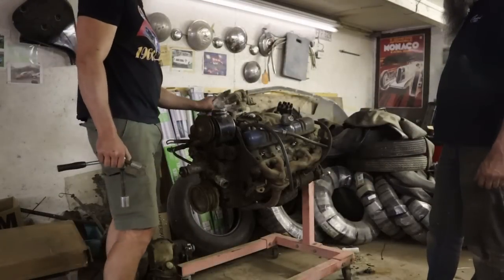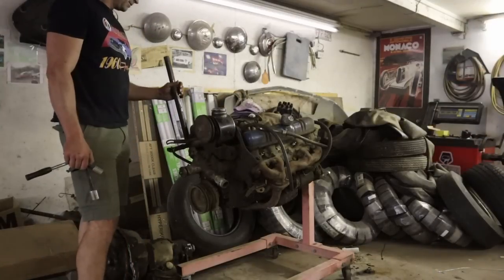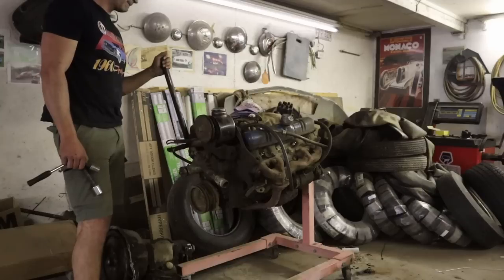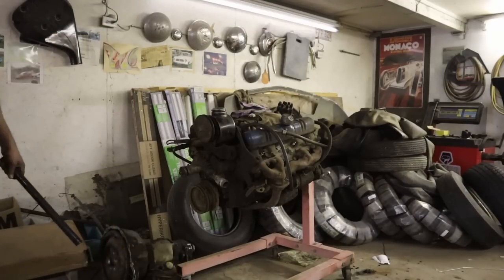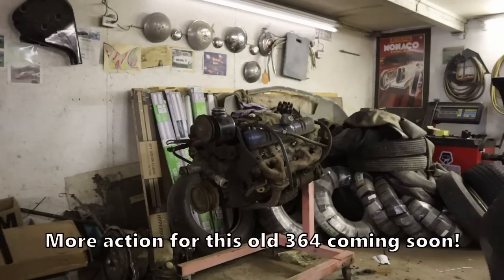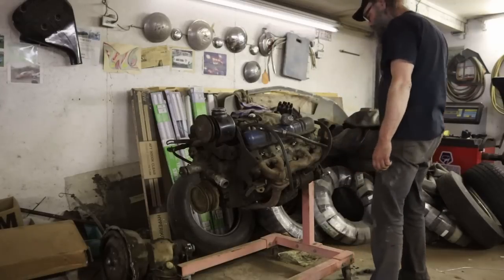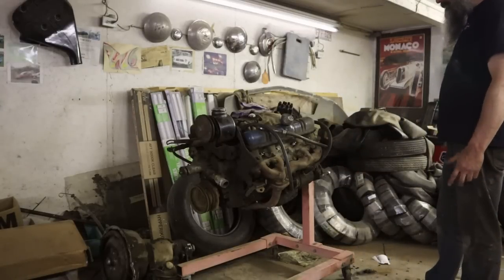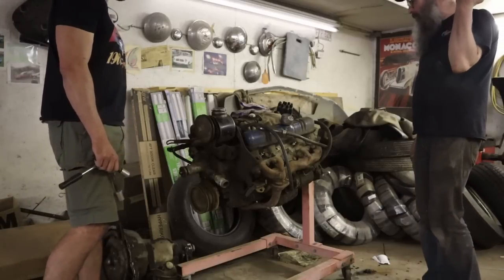It's a better start than we've had so far. Although we have one that runs. Yeah. The clanker. But I think this is at least worth a quick look. Take the heads off, take the pan off, see what's left of it. This one, to drop the pistons and rods should be easy. Stick them aside, swap rings, back together. We clean it up as we tear it down. I'll start with just a scrapey, wipey, level one kind of tidy on it. And one afternoon we have it stripped into major components. And then we'll know what we gotta do.